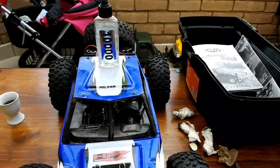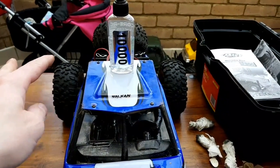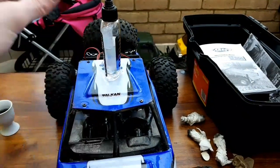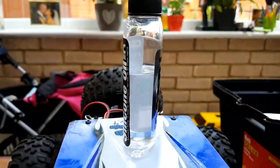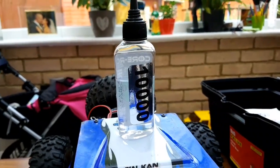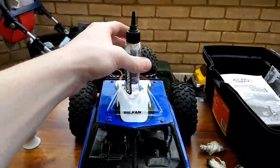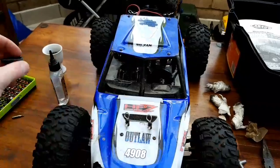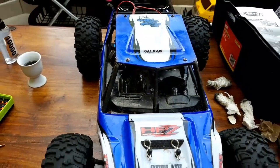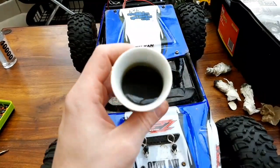Out of excitement I've also changed the oil in the shock absorbers at the rear of the car. The capacity of the rear shock absorbers is slightly bigger, so there's a bit more oil going into them. Filling all four shock absorbers together, this is how much oil is still left in the bottle — about two-thirds. So I could probably do another two changes with the same bottle if I had to. Let's take the car outside now and see how it behaves on the road with the oil changed in all four shock absorbers.